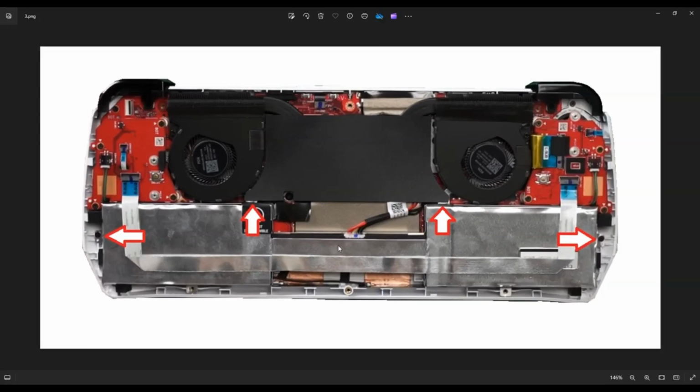A word of caution I give anyone when working on any sort of electronic device is the first thing to do when inside of it is remove or at least unplug your battery. That further limits power from moving about your motherboard and it limits the chances of you damaging anything. As a side note, to help with that, I have my electronic devices sitting on anti-static pads when I'm working on them. Or an anti-static bracelet.